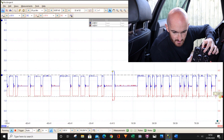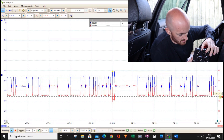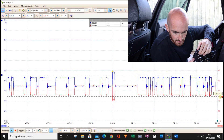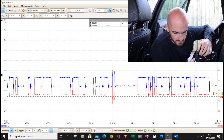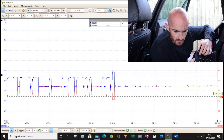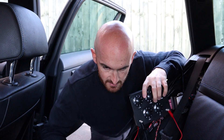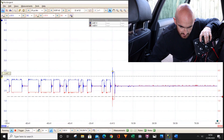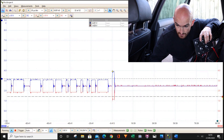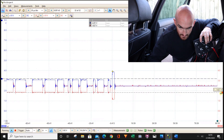You can see that change between 100 ohms and 90 ohms — so we've got around 200 ohms total there. Let's start dialing the tens down now. At 99 ohms, we can see them coming away from the support lines, starting to go a little bit fuzzy. At 60 ohms, 50 ohms, 40 ohms — look at that now. They've gone away from the support lines; we're not measuring the same voltages anymore. We were at 3.6 volts and we've actually gone down to about 3.2 on CAN high. CAN low is going down to about 1.8 volts.